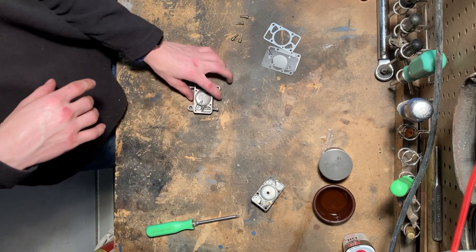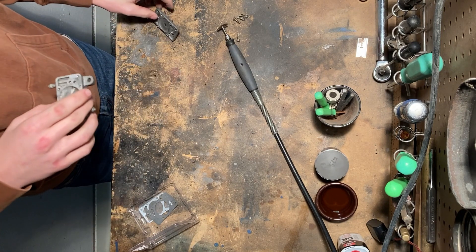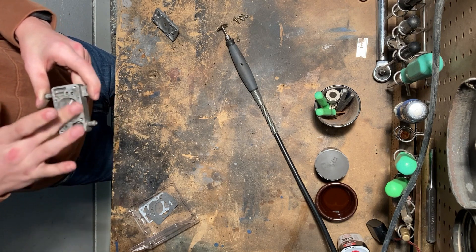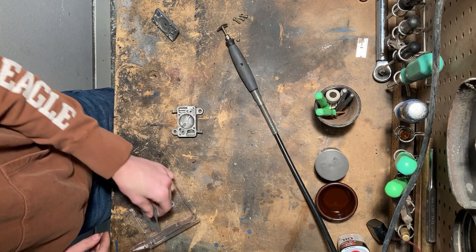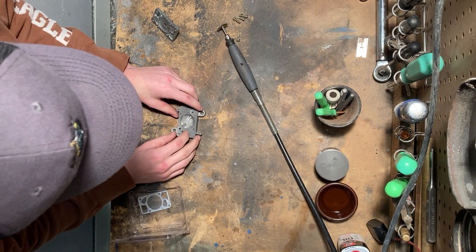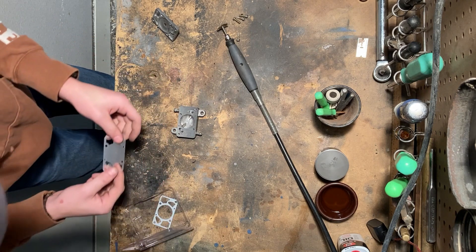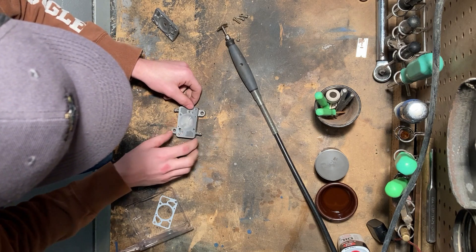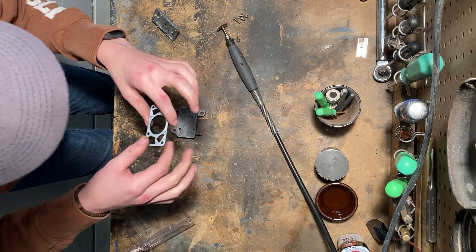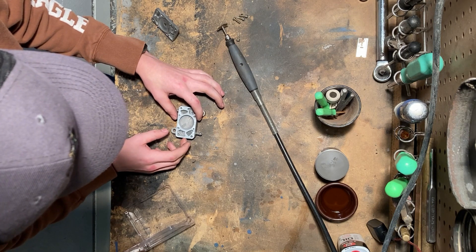Now I've gotten all of the residue from the old gasket off the top and the bottom, and I've cleaned out all the sludge in all the fuel valleys. Now we're ready to put it back together. First you're going to put the thinnest gasket — make sure you get this on the right way, there is a correct way and it will not work the other way. Put the thinnest one first, it's one-way black, and then the clear gasket. Make sure they're all the right way. Your last gasket is the thickest and it's made out of what you'd normally consider gasket material. See, that's the wrong way.